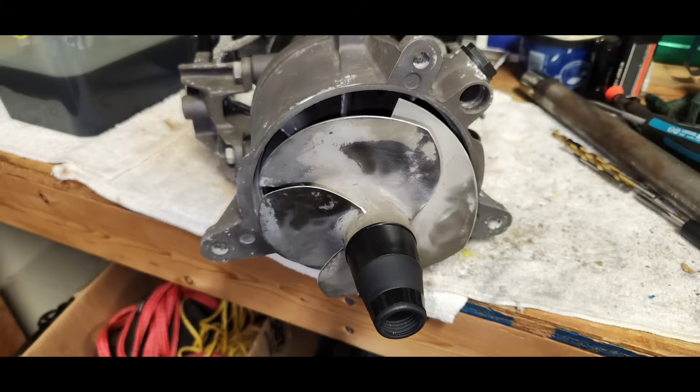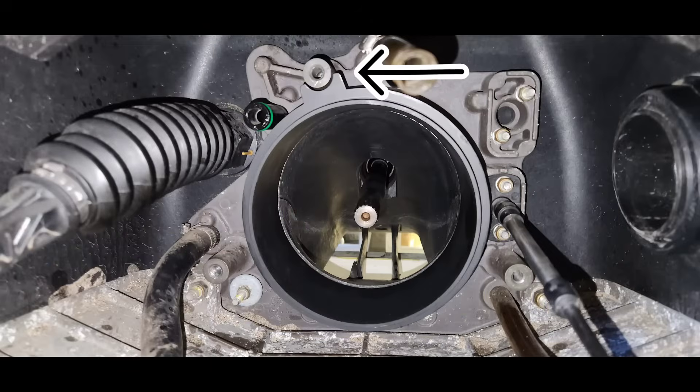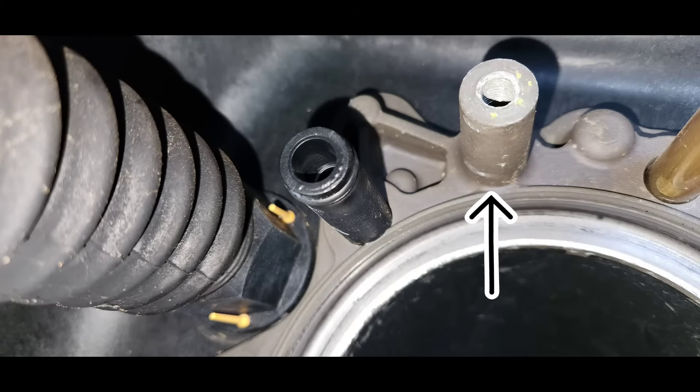This is the assembled jet pump without the wear ring. Take a second or two to install the wear ring on the pump itself and on the transom plate. Be sure the pump moves freely, the wear ring fits properly, and the front seal is installed on the new wear ring. I prefer to align the wear ring alignment notches with the mounting bolt protrusion rather than the plastic water tube, because when the wear ring spins it's less likely to damage your water tube.